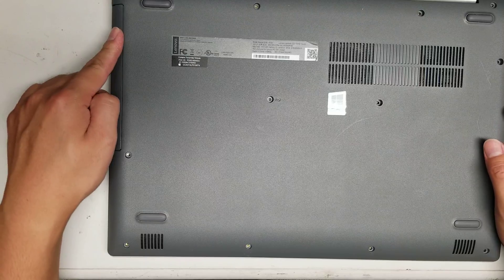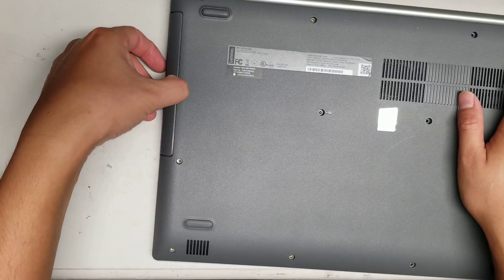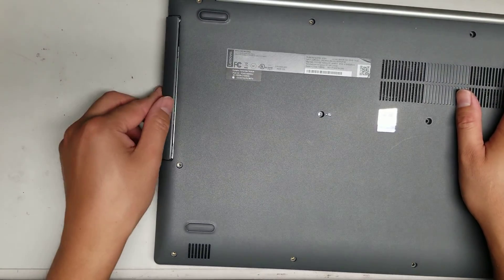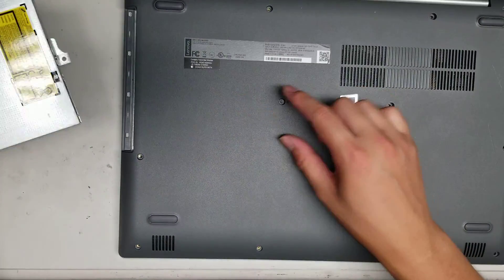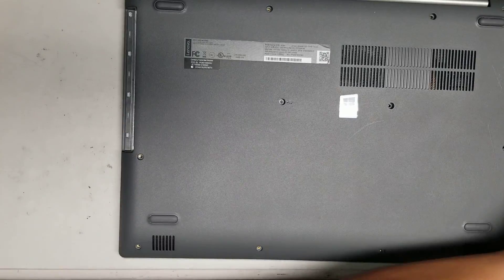If you're just trying to remove the CD drive, you only need to remove this one screw. Once you do that, you can pull the CD drive out — just pull it like that. When you put it back, sometimes it might get caught. If that's the case, just flip the computer over and then you can push it in. Sometimes this metal piece will sag down and get caught, so sometimes you have to flip the computer over.